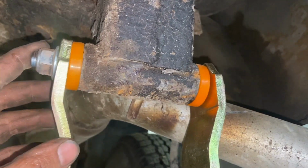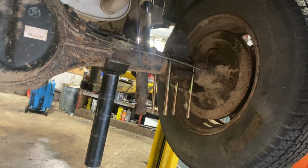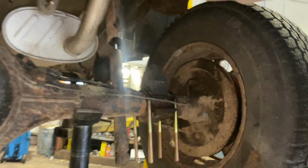Just see now, that's just pulled that in, and you just want to back it off and leave all these floating while you get everything mounted up. And once it's mounted up in place, that's when you ought to be nipping everything up. So we'll get the springs mounted on now, put the shockers over, give all the bolt threads a decent bit of copper grease on them, and we can just run round nipping everything up.